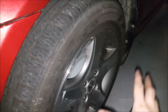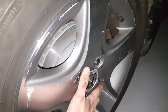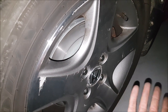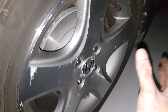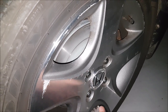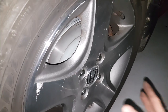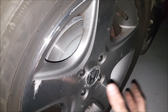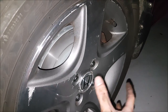Whenever you're servicing anything — especially brakes and chassis — make sure you're using a torque wrench and torquing everything down to manufacturer specifications. Whether you do your brakes yourself or have a shop do it, re-torque them yourself when you get home. Loosen off the lug nuts, put them back on, and use your torque wrench. Make sure your torque wrench is recalibrated. A lot of shops use torque sticks, and torque sticks work when they're fresh but they have a lifespan. If there's uneven pressure you can warp your rotors prematurely. Especially with aluminum wheels on newer vehicles, make sure everything is torqued down correctly.